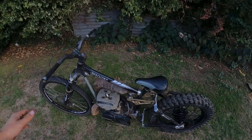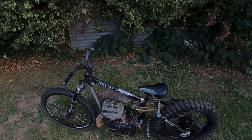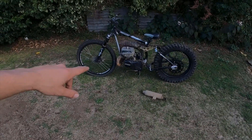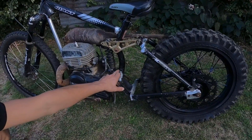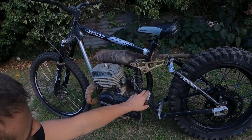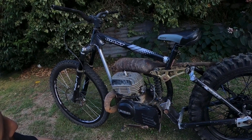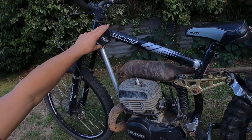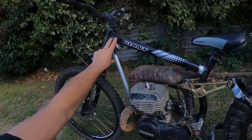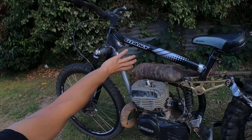I've got a lot to do — it's far from finished. The motor wiggles in there a bit but I'm pretty happy with how it looks. It's actually heaps lower than what it's going to be, but I might make an adjustable mount. If I turn this shock around I have room to fit the carburetor, so I might make the shock mount adjustable for different heights. I need to replace this whole top tube with a thick one I can also use as the fuel tank, and I need a place to hide the electrics — maybe section off a bit of frame and make a little box.